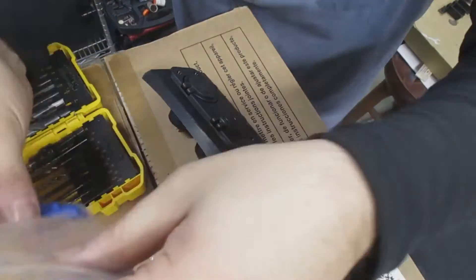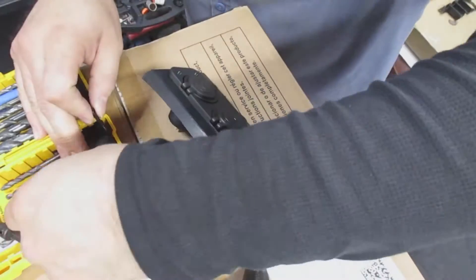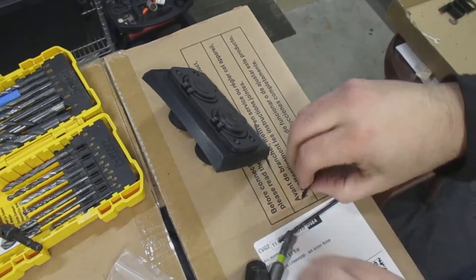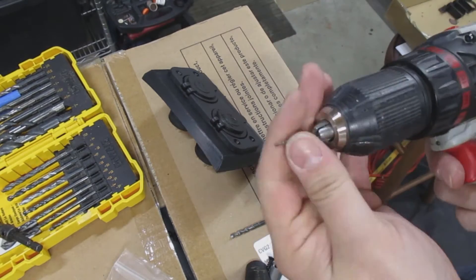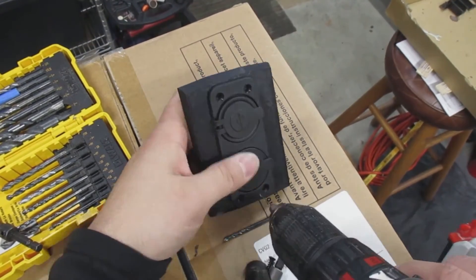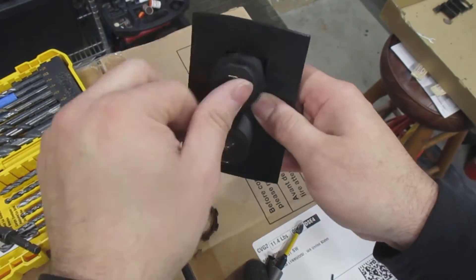Here's the bracket that I'm going to be installing instead of the ashtray holder. First I'm going to drill four holes so the screws can be installed. I'm going to be installing the screws through the USB bracket into the bracket that's going to cover up the hole for the ashtray holder, and those screws are going to go into the plastic of the car.